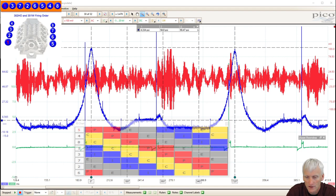So anyway, that's what it ended up being. When we took it apart, the cam lobe was a little wiped out and the lifter was wiped out, and that was causing the misfire and the noise. And the root cause for the failure, we found out, is that the push rods were too long and they were operating the rocker arms out of their neutral position, if you will, at an extreme. And I think the rocker arms were binding up there on the rocker arm studs, probably putting undue pressure on the lifter and cam, and that led to its ultimate demise. He's replaced all this with the right size rockers, right size push rods, and a roller cam and roller lifter set. So it's all good now.